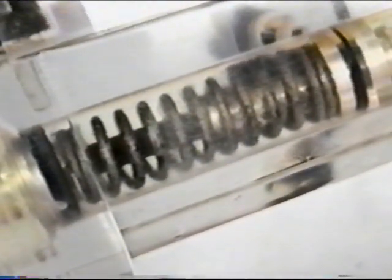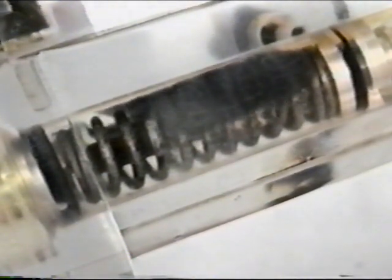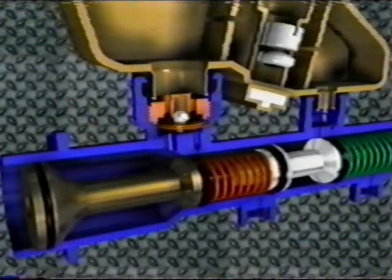Pressures this high, as well as large amounts of fluid, can disturb the sludge and corrosion that is built up in the system. This video shows the old fluid from the wheels entering the master cylinder as the piston is pushed back. This fluid could carry contaminants back into the brake valving, ABS modulator, or master cylinder that could do damage to the seals or internal parts.